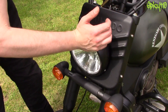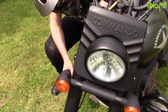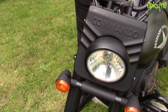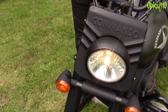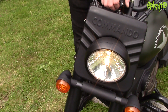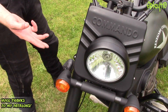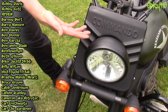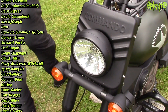Then the height adjustment — it was basically all the way back. Let's check where the marks were — yep, all the way back. High beam, low beam — working, no problems. Check the indicators — yeah, we haven't dislodged any wires doing that. So there we go. That was actually just two bolts, three bullet connectors, and one multi-connector. But it was one hell of a job given my hand size and the access, because of the way it's set up.